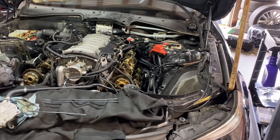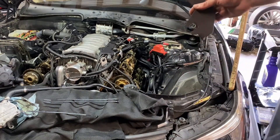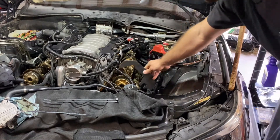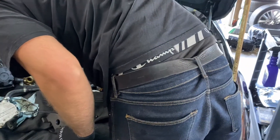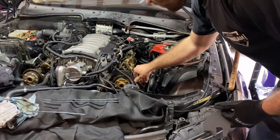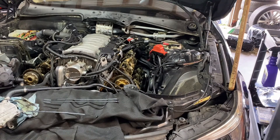In this kit that has the cam timing, there's a pin and you put your motor at top dead center and then you pin it. It goes through the crank pulley into the front timing cover. The kit comes with these two jig pieces for the cams. There are slots on the cams - this is the exhaust side - and both sides sit level on the head at top dead center. I'm doing this because it's an eBay kit and I want to verify that when I put it back together it'll go back together correctly. It does, so now I'm comfortable with that knowledge.